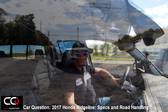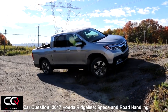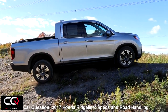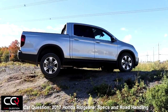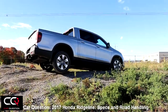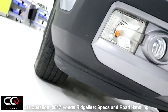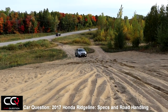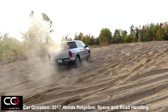Off-road is really important to me. For serious territory I need something more capable — something that can lock all four wheels. What the Ridgeline has is an intelligent mode that brakes wheels selectively for better traction. But the ground clearance isn't impressive — only a 21.1-degree approach angle. Be careful with that front plastic; if you're going into rocks, remove it or you'll hurt the truck. Departure angle is 22.1 degrees, ground clearance is 8 inches. The underbody is not as well protected as competitors.